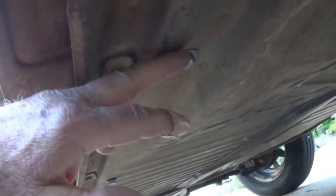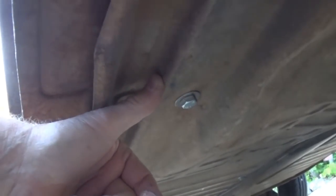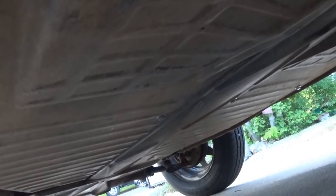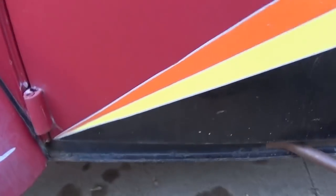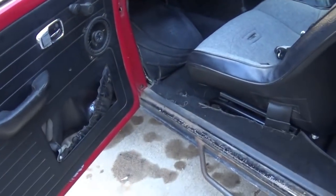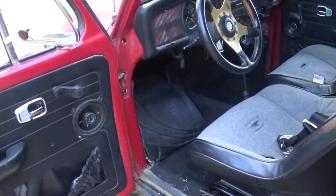I ran 3/8 bolts up from the bottom and used washers. It's close to the edge of the pan but they all lined up in a pretty good spot — there's the front one, so you don't get into the tunnel but you're right next to it. I hate to make holes, but it seems like mother nature makes plenty of holes with all the rust. I've got some rust issues I should address with some phosphate treatment, but they're really comfortable.